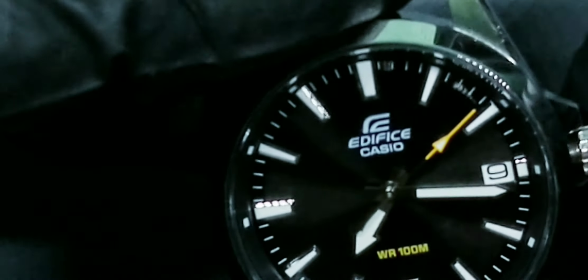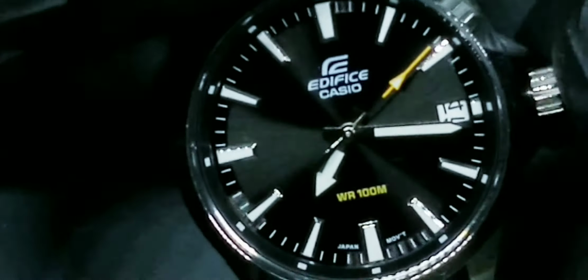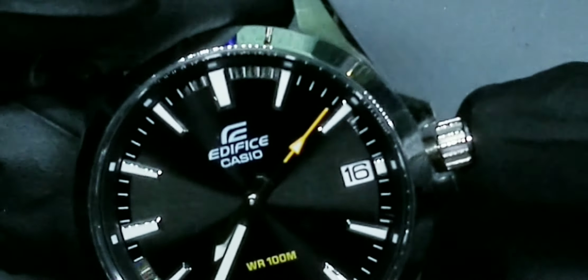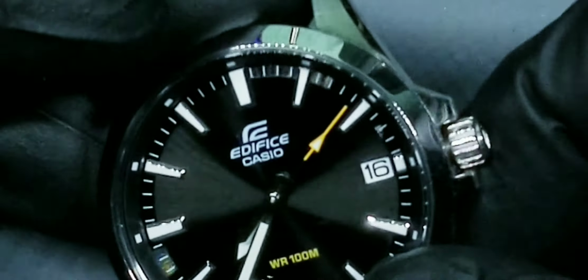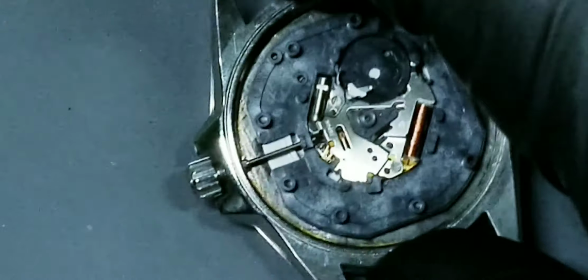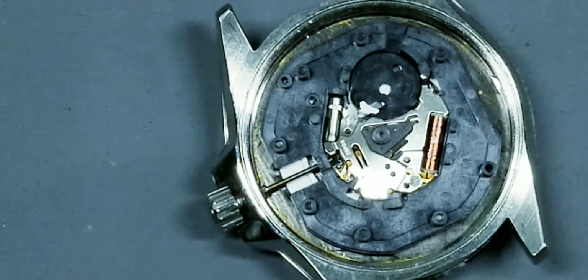Turn the watch over and turn the crown, and that should adjust the date. Try to pull the crown out to position 2, and this should adjust the time. Push it all the way back in. Turn it, and nothing should happen. So that tells me that we're in the correct position and the stem is fully inserted back into the module. Okay.